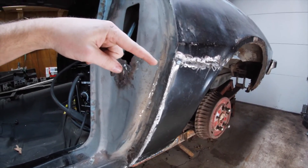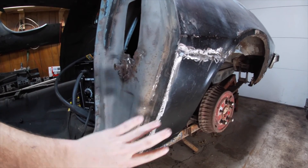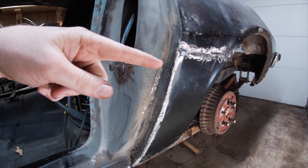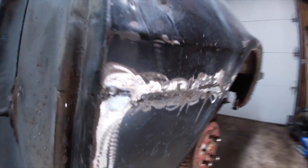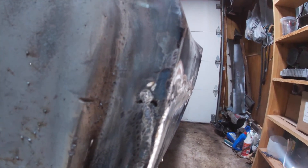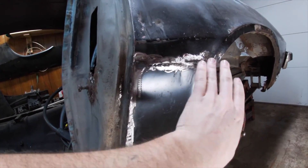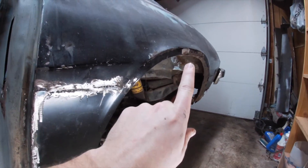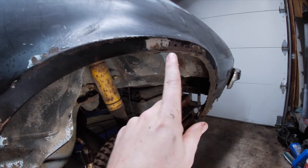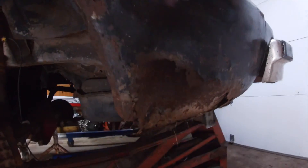As you can see, we've started working on the quarter panel here. All of this was damaged prior. I know I wish I could have recorded it, but we did do some work. Up here at the top, we do need to come back and get this straight because there is some waves and it's sticking out in some places. So we're going to get in there with a dolly and hammer that all back in. We're going to finish welding up any spots that we need. But then we also have a lot of damage here along the wheel well, as well as back here. It is bad. So this is what we're going to be working on.